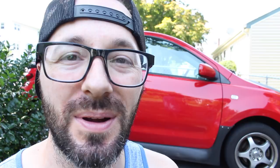Now that everything's off the car, I'm gonna hit some spots with some sandpaper — maybe 60 grit or a little bit higher. This way it gives the chalkboard paint something to really bite into. I put some temporary paint on the side skirts and bumper and just kind of brushed it on there, so I want to get those brush strokes out so when I roll on the chalkboard paint it goes on smooth.